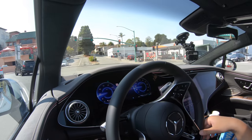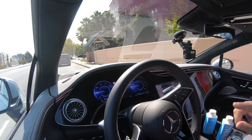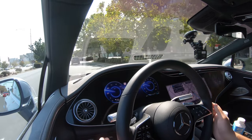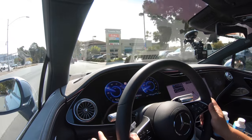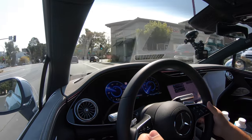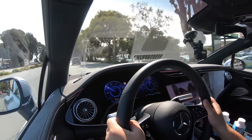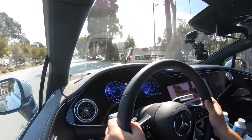The rear steer is a big standout, as is the throttle pedal calibration. Back in comfort with increased recuperation — I'll keep an eye to see if it remembers the mode. If not, it's just one click on the left paddle. There's another mode: hold the left paddle for intelligent regen, which increases regen as you get closer to the car in front. Trying that — accelerating up, big regen, and big brakes. It's like adaptive cruise all the time.